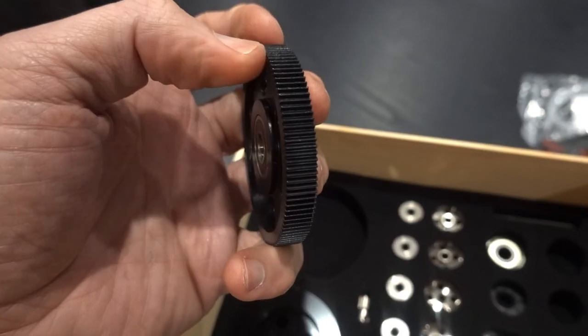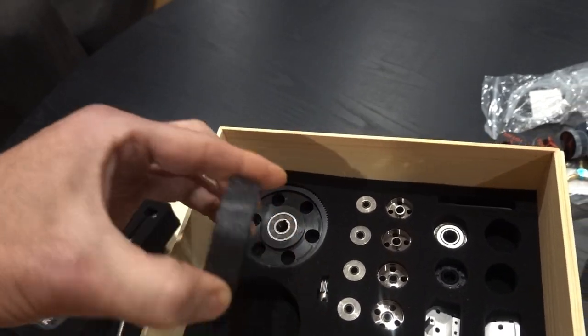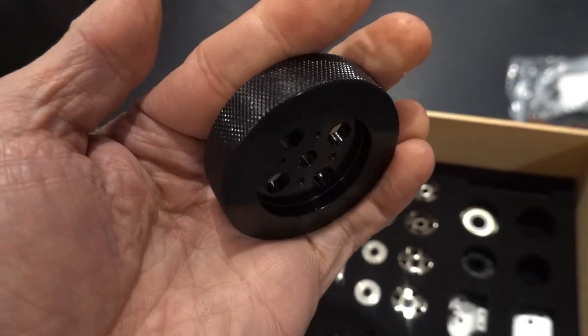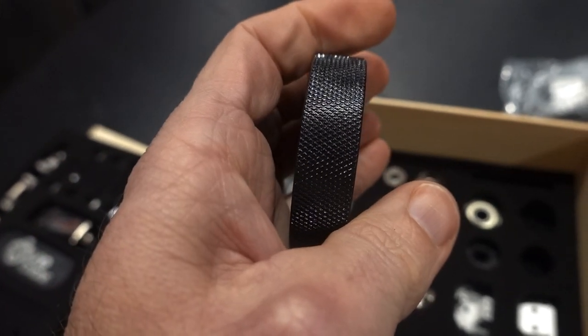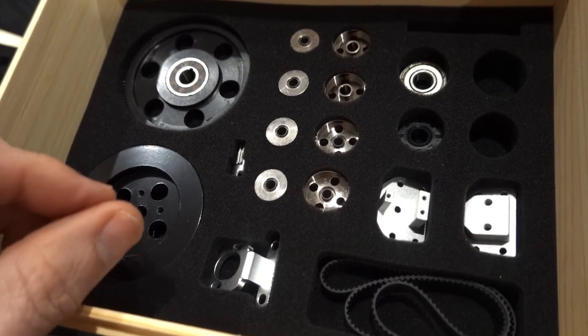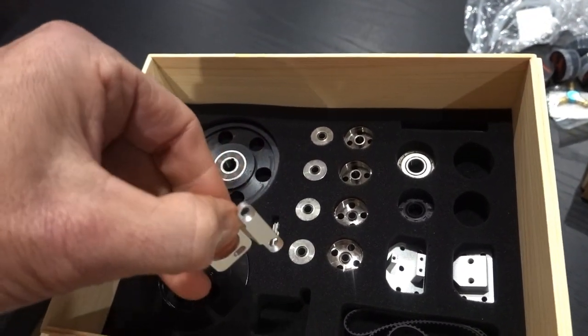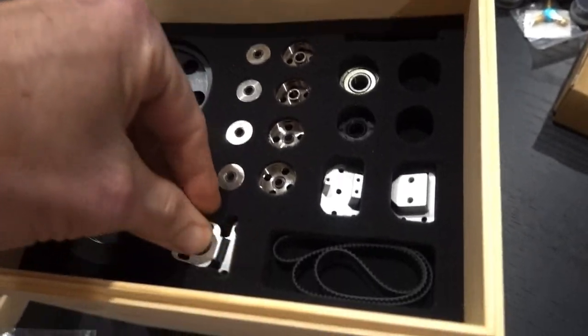There is the gear mesh for the starter motor to run against, and you also have your flywheel here — pretty damn heavy, pretty damn thick too, like 11 to 12 millimeters thick. All these little pulleys and cams — because it is water cooled, it'll have its own little water pump in there as well.